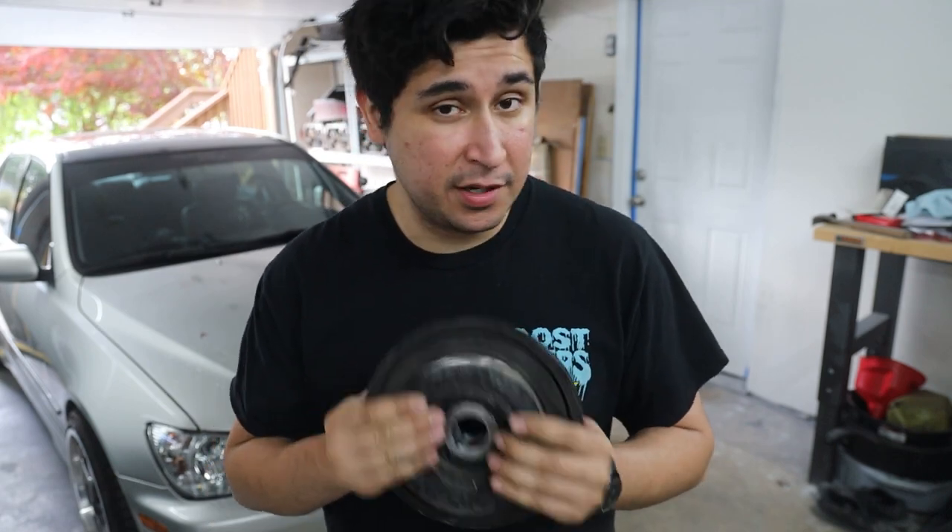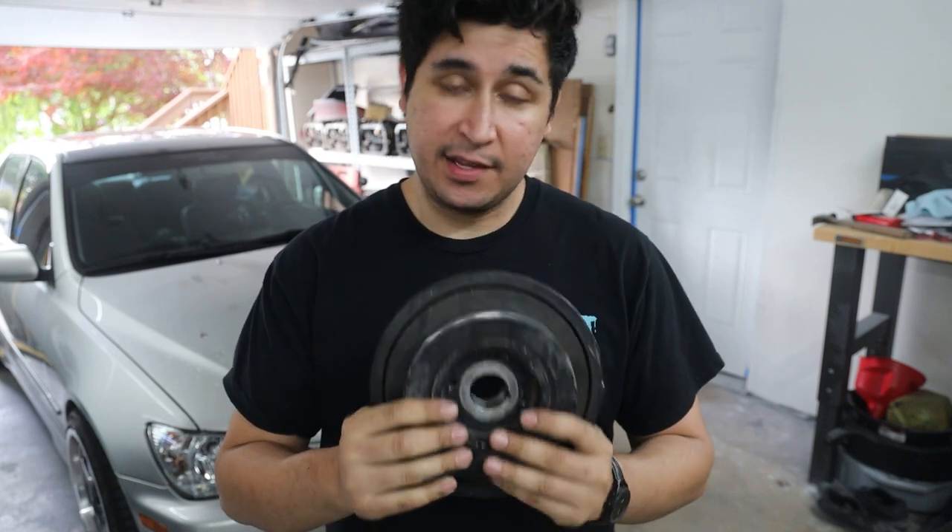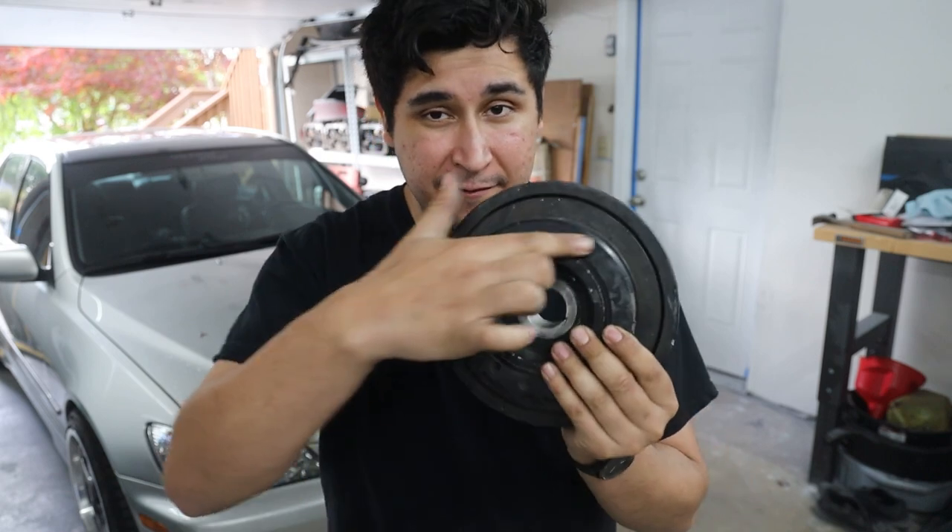What is going on guys? Hope you guys are having an amazing day. My name is Ervin and today we're going to be fixing the 2JZ's Kryptonite — the harmonic balancer. These things are pretty notorious on 2JZs for going bad. They're a two-piece construction: they have the balancer and then the actual pulley on it. This mates with the drive belt and spins all of your accessory drives. The two pieces are joined together by one very small piece of rubber, and when they get old, they separate and you get all kinds of failures.